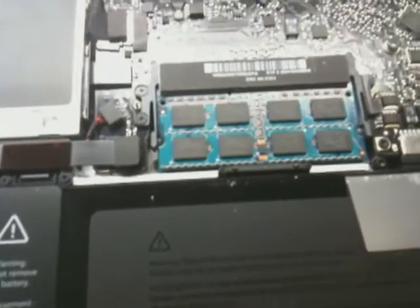You can see there that it has two little knobs right there, and the other one is right here. Those are going to actually push out and then the memory modules will pop back out. We'll do those one by one and then take out the rest of the memory so we can replace it.